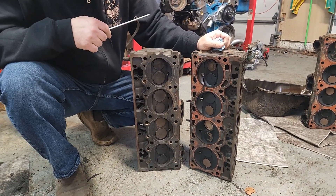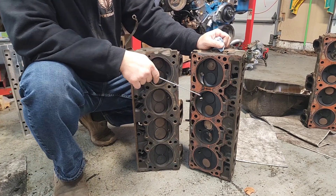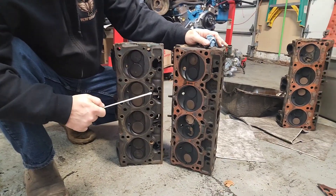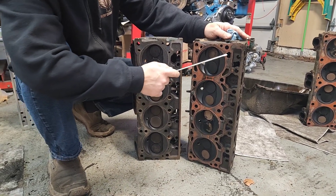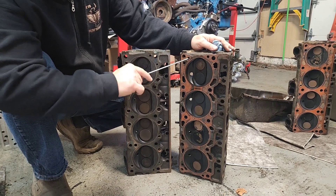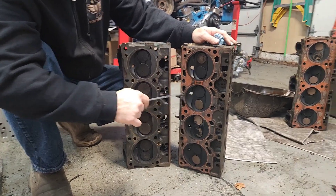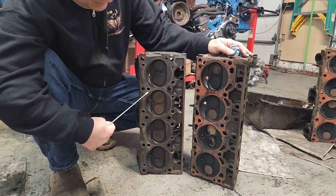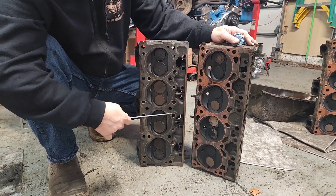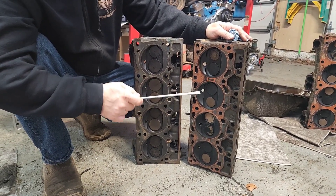My number 17 heads look a little deeper — I think they are 72cc heads. The 301 is supposed to be the same. One of the biggest differences is the coolant passages. On the 301 we have what I call windows — the coolant goes around the combustion chamber. On the 350 head we have just round holes. That's going to be important later.